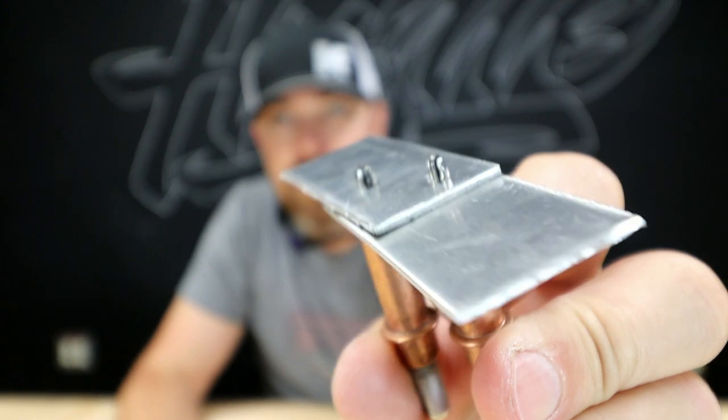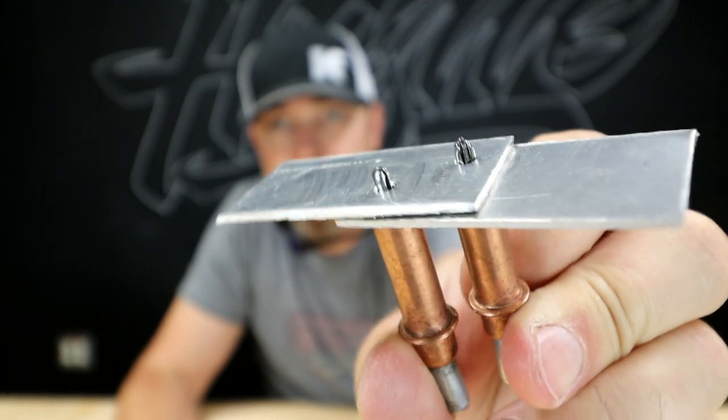See, those things are kind of holding on. The really nice thing about these is you can access panels really quickly. As you're building something, you can drill some holes where you would actually run some kind of bolt, but in the beginning you can just use an eighth-inch hole. This thing will hold those panels on the vehicle where you want them, so it's easy to pull on and off as you fit the pieces. Then when you're finally done and ready to put it on, you have eighth-inch pilot holes already lined up and pre-fit to the whole design. You can then use those pilot holes to drill the hole you need to actually mount the panel.